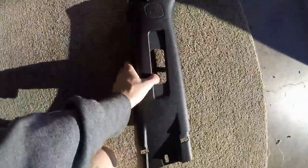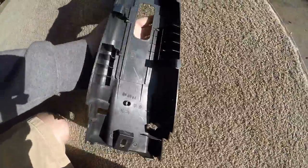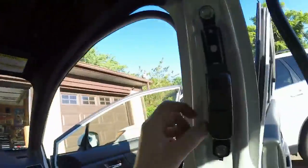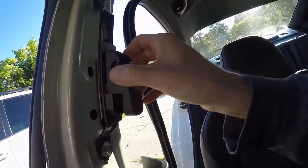Alright guys, let me show you what this is about — your seat belt adjuster. No screw behind the SRS. This is the B-pillar, the middle pillar; A-pillar is in the front, B is in the middle, C is by your back window. It has one really tight clip and one bolt down here, and the rubber trim slips into these slots. As I expected, the noise is the slider unit, so I need to find some way to insert something and tighten this up.